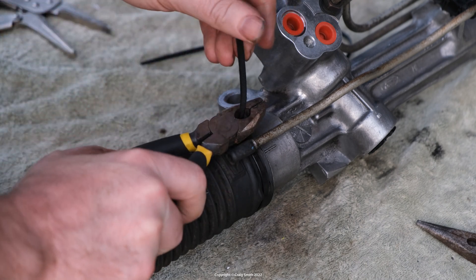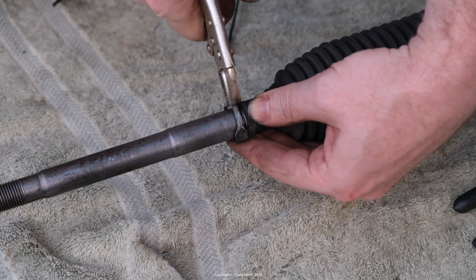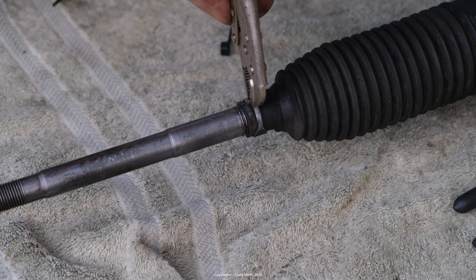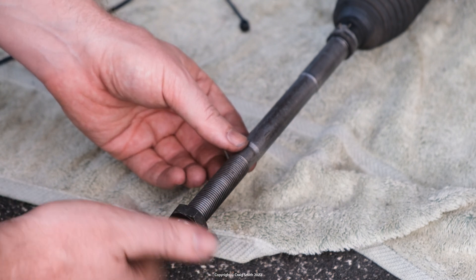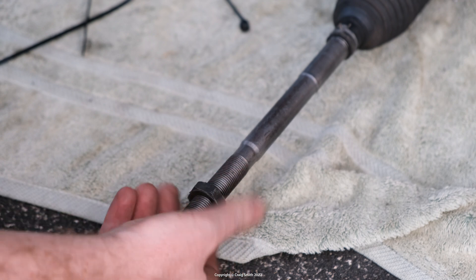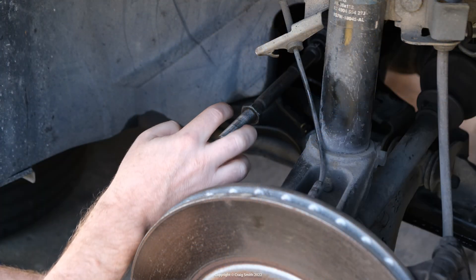Vice grips on the spring clamp handle the other side. There are obvious sections marked on the rod for where the sealing bit of the boot sits — once clamped, the ridges on the rod will keep the boot positioned correctly even as it concertinas in use, so make sure it's in the right place before you release the clamp. This is the locking nut for the outer rod — make sure you put that back on before threading on the outer rod. The nut has an orientation: the flatter side needs to be facing outwards so it butts against the outer rod.